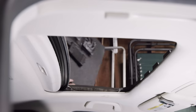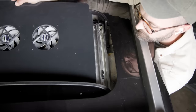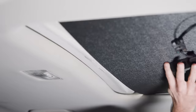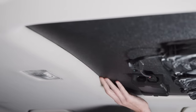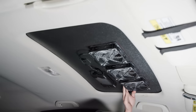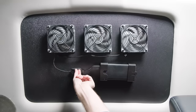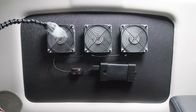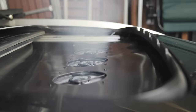The sunroof unit is just as easy to install. With the sunroof open, I slide the unit in, making sure it's between the aluminum rails, then insert this end into the headliner — that's why I made it longer than the opening. Once it's installed, I just turn this little knob, and this thing really pulls a lot of air through without making much noise at all.